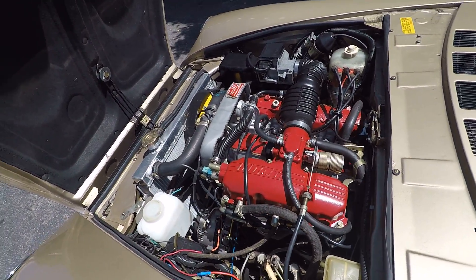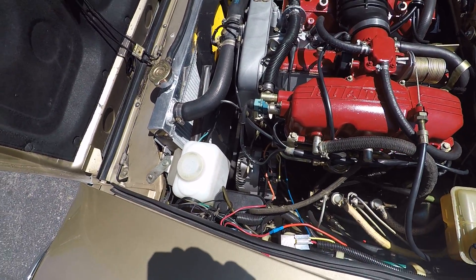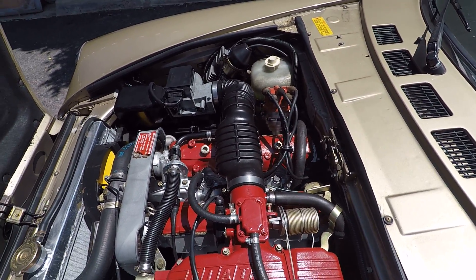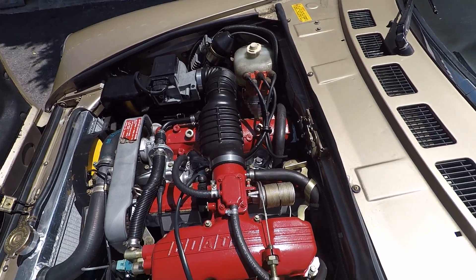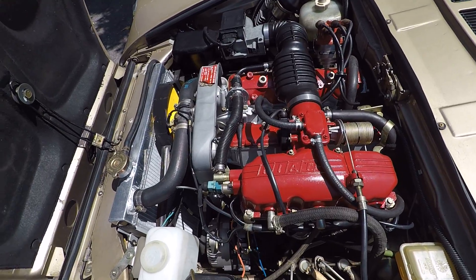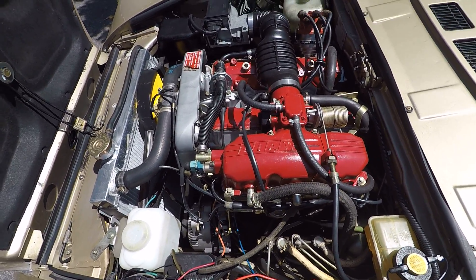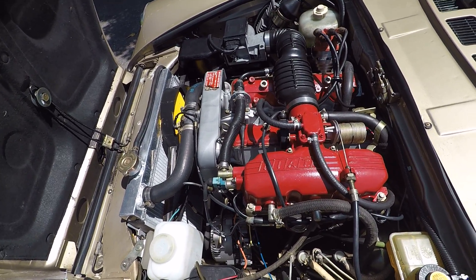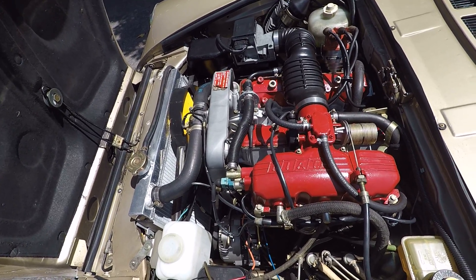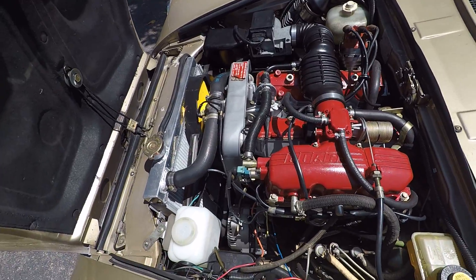Since it's an '81, it's a fuel-injected two-liter engine. This car got one of our aluminum radiators, a 95-amp alternator, and our 123 ignition — a programmable distributor that puts out about twice the voltage of the stock system, which really helps with drivability especially with the performance mods. The engine received an upper-end overhaul with our street performance cams designed to work with fuel injection. They have great mid-range power from about 3,000 up to 6,200 RPM. We've also done a little dress-up on the engine to make it look nice under the hood and match the exterior.